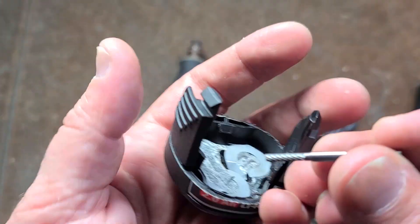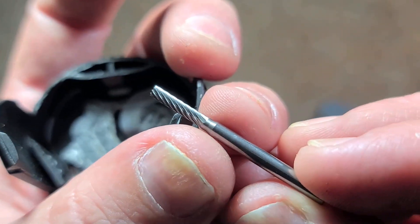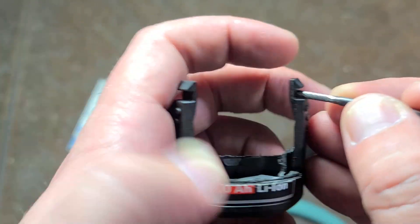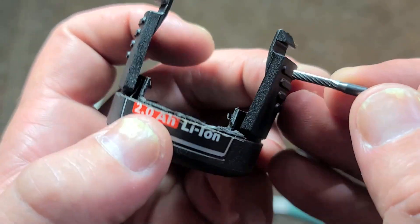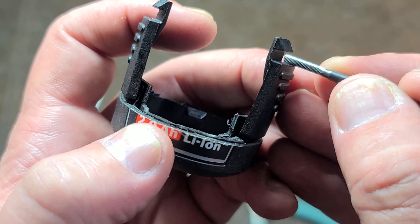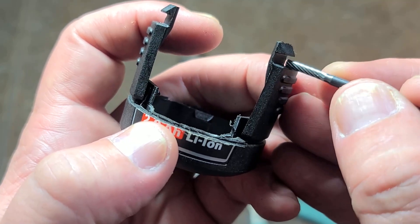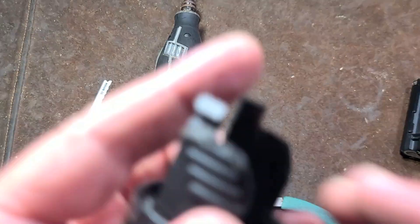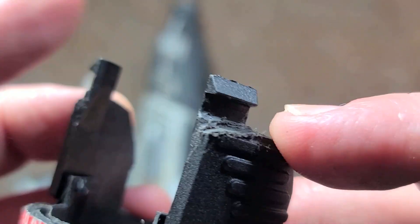I noticed there's just a little bit more clearance — a slightly bigger gap — on the Dremel battery compared to the Bosch. The clip positions and everything else are correct. What I learned while cutting is that this casing has fiberglass in it, and fiberglass dulls blades super quickly. I had to switch over to a high-speed steel metal-cutting blade. Now I'm going to use a Dremel carbide tile bit to lightly carve around the area to give it the necessary clearance.